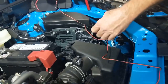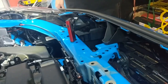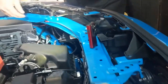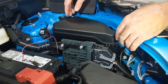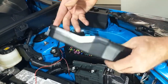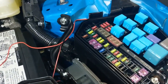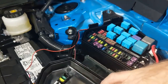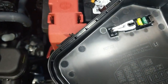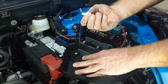We will wrap the harness over to our fuse panel. Now that we've got our wire loosely routed, we're going to go ahead and take off the panel lid. What we're going to be pulling out is this fuse right here — the 7.5, which I believe is the USB 2 hole — and this will be for accessory-on lights or accessory-on power. You can use a little puller here.